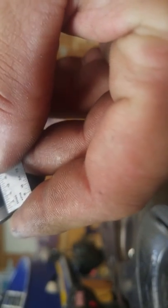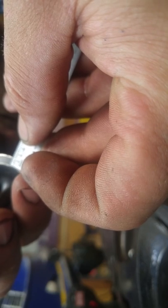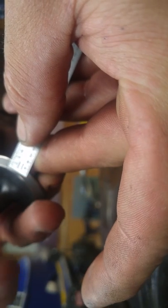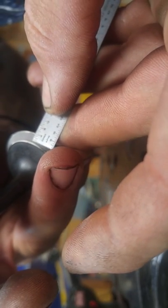I've already lapped these a little bit earlier - I just haven't done the number four cylinder, so that's what I'm working on now. Let's see if we can focus in there - it's getting better. Now what you do is you take your machinist rule here. Our spec is in thirty-seconds of an inch, so we're going to measure the little land area there. We have about three thirty-seconds right now.